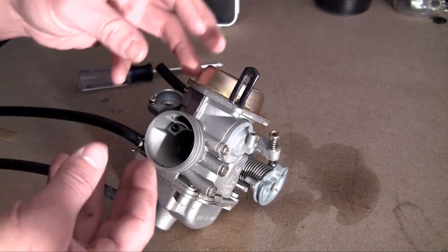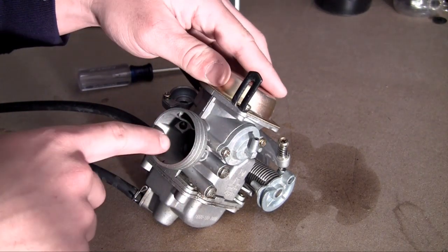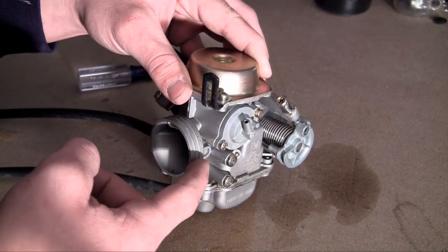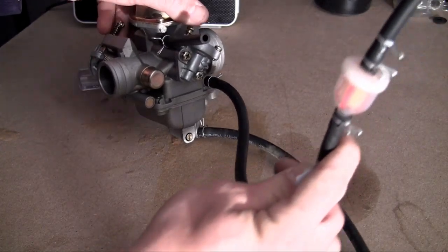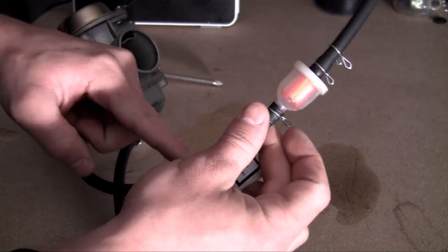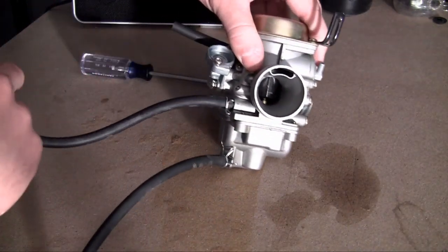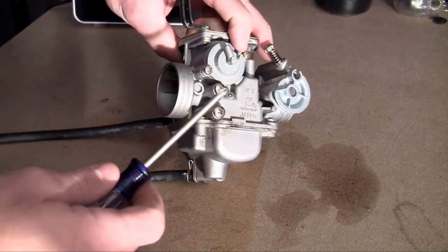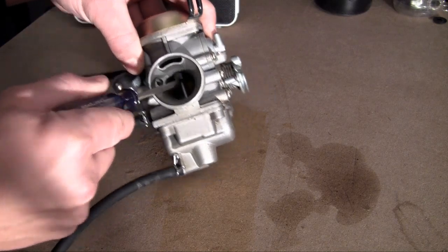Before this thing can mix it perfectly, it needs both of those things. Your air intake is going to come in and go into a tube connected right here — that's where the big air hose is going to go. Whenever we hook up our air unit, it goes right here. For the fuel line, the gas tank is actually going to be hooked up right here. It's going to go through this fuel filter, which cleans any crud out of the gas, and then go into your carburetor as well. Now your carburetor has that perfect balance of air and fuel and it can mix it.